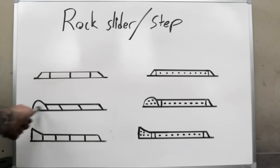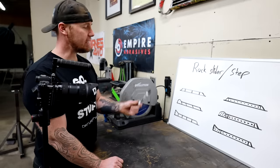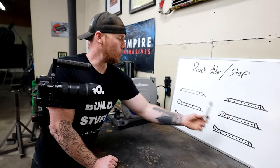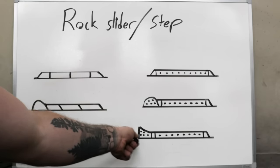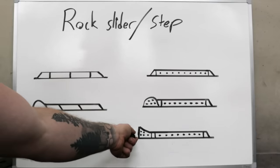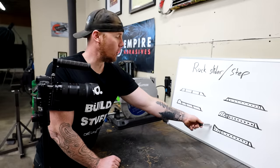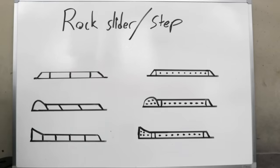If you go with the angled style, you can still do the same dimple die treatment — people just take flat plate, drill some holes in it, punch it with some dimple dies. Now the reason I don't usually integrate these angled styles into my builds, even though it's my favorite look, is because I've been on the trail multiple times with people who have this style. If you have a small tree that the muddy trail has made you lean into, it will just fall in between your tire and your slider. To get you out you can't go forward or back, and we usually have to take a high lift jack or cut down trees to get unstuck. To me it's not worth the occasional benefit of kicking a really big rock away from your tire.